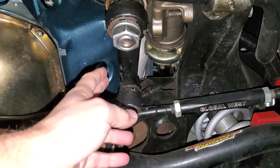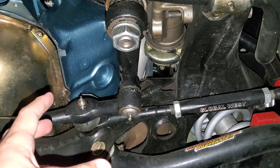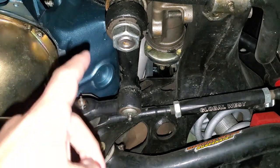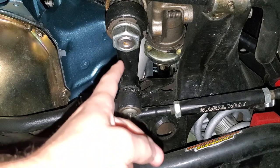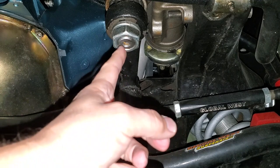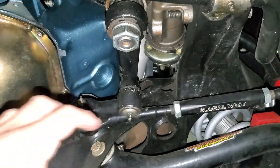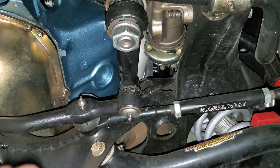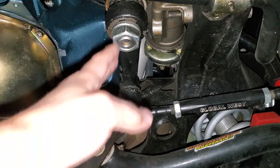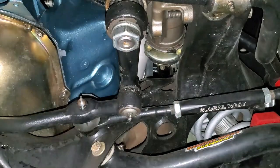For those of you with older cars where you can take your steering wheel off and rotate and put it back on — don't look at whether your steering wheel is straight or not. Look at your pitman arm off the steering box. Make sure that's perfectly straight. For those who don't have a pitman arm — maybe you have a rack — I'll give guidance below for classic cars to determine where dead center is. So make sure you're dead center.